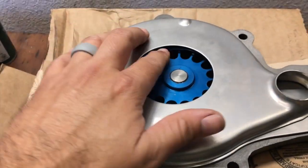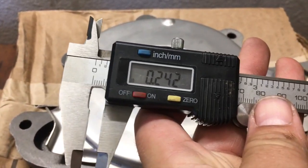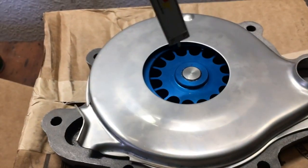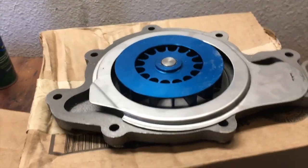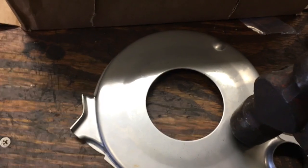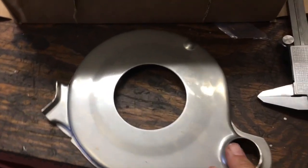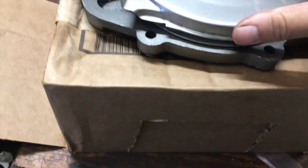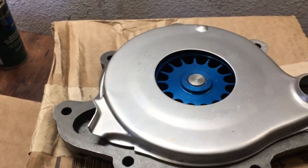The next thing is to get this gap down. Right now the gap is 0.242 down to that metal, and I'm going to try to get it down to 0.10 or somewhere in that area. I'm just going around with a hammer, tapping it and measuring - it was at 0.240 and now it's at 0.218.